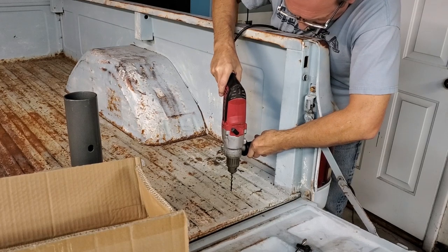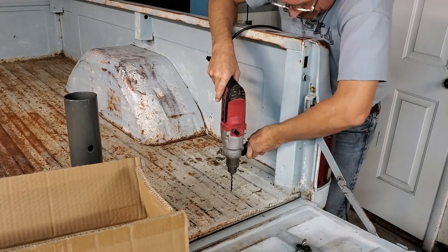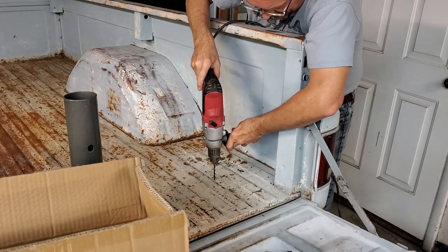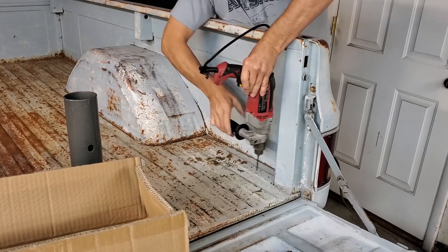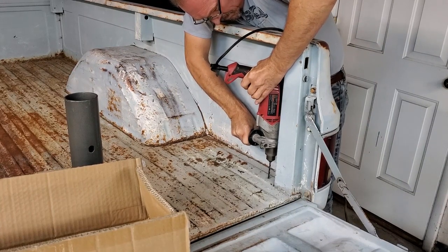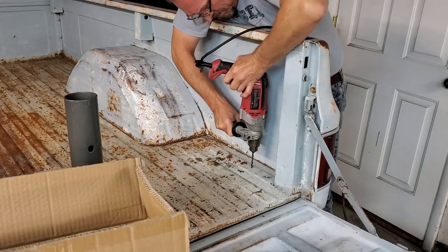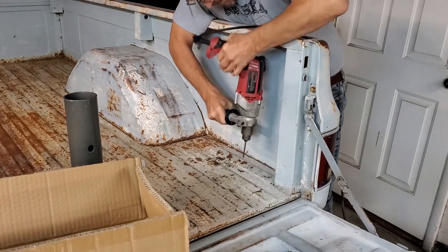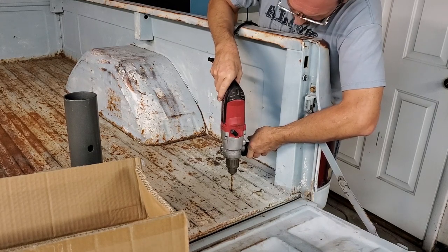All right, we're going to start by drilling quarter-inch holes, or just under quarter-inch, right here, and our center points we mark with our marker. There we go. Next one. Slightly larger drill bit size, so we drill out the holes, because the next thing we'll do is switch to a Vari-Bit and enlarge it to the correct size.